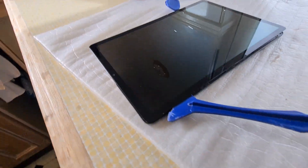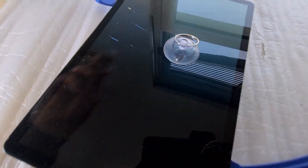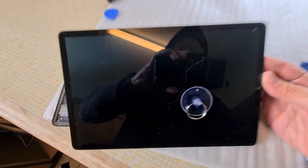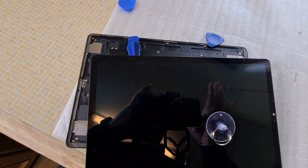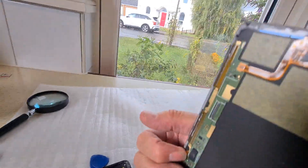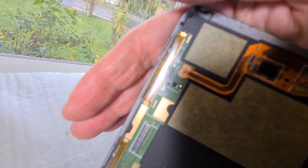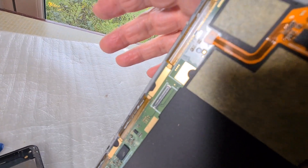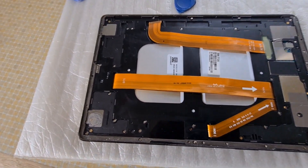It's lifted up more now, so I'm going to use my suction cup to try and pull the screen off. I managed to use the suction cup to pull it up — it's looking good. Just a reminder that the actual screen pushes into the connector, so it just needs to be prized off. Sometimes it fell off last time I replaced this screen. Right, that's the first stage over with.